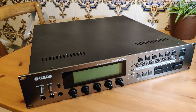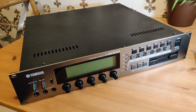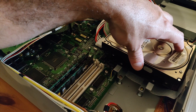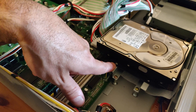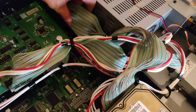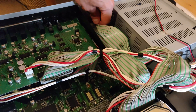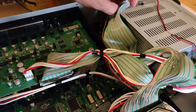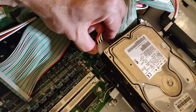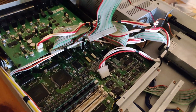So I'm going to go ahead and open this bad boy up and start taking things out and putting things in. The unit's open, and I'm going to take out this drive. For the sake of time, I went ahead and unscrewed this bracket off the base, so it should pop right out. I also have to be careful because there are quite a few ribbon cables in here. This one corresponds to the SCSI in the back, so I'm going to go ahead and pull this out. This is the one that's connected to the drive, and I'm also going to unhook this power cable here.